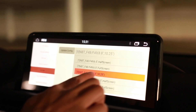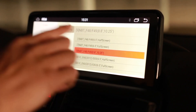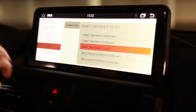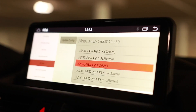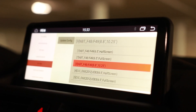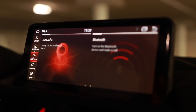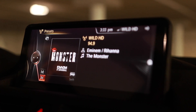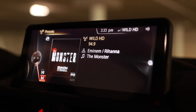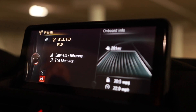That's why we're going to select this, even though it doesn't specifically say F22. This is the one that we want. Press it again in order to get this screen to pop up. Hit the check mark — do not hit the update configuration. As soon as you're done with this, the car is coded. Turn it off and then turn it back on. Now that we turn the car back on, everything should be coded just fine. Hit the home button, go back into the car side. You can hit car info, and there it is — no more split screen. Now you do have the option in the menu setting, so if you hit the forward button, you can always go back to the split screen.